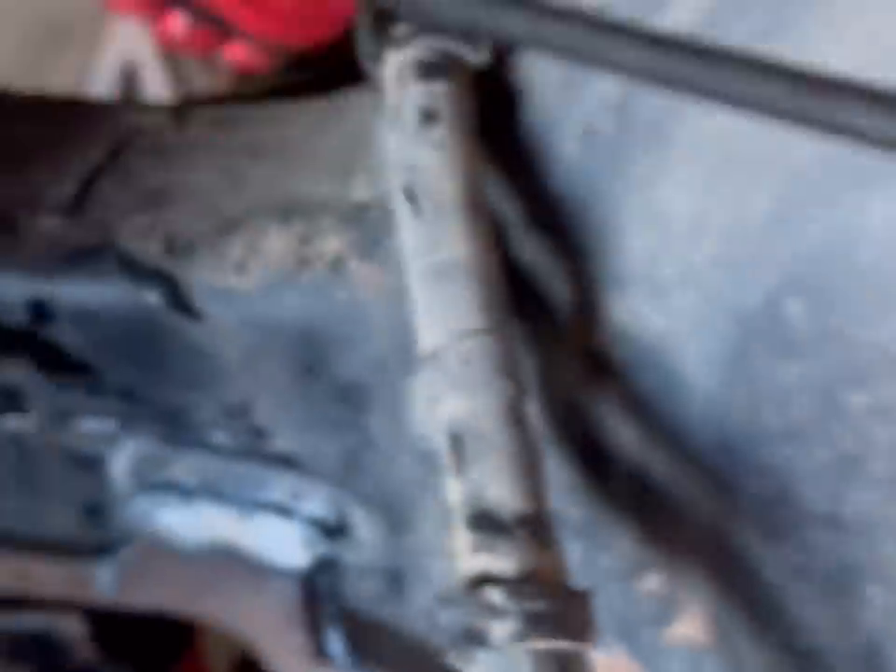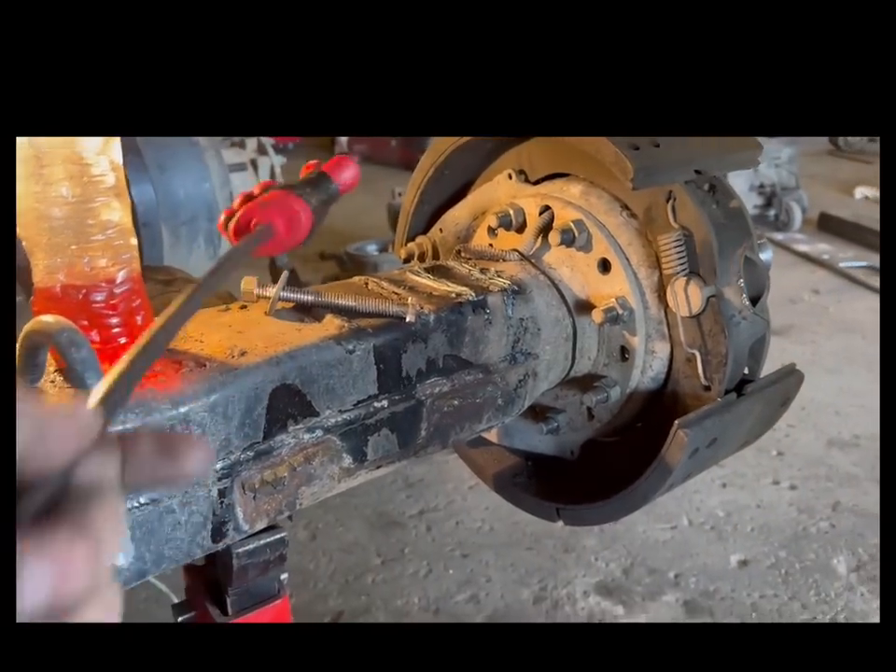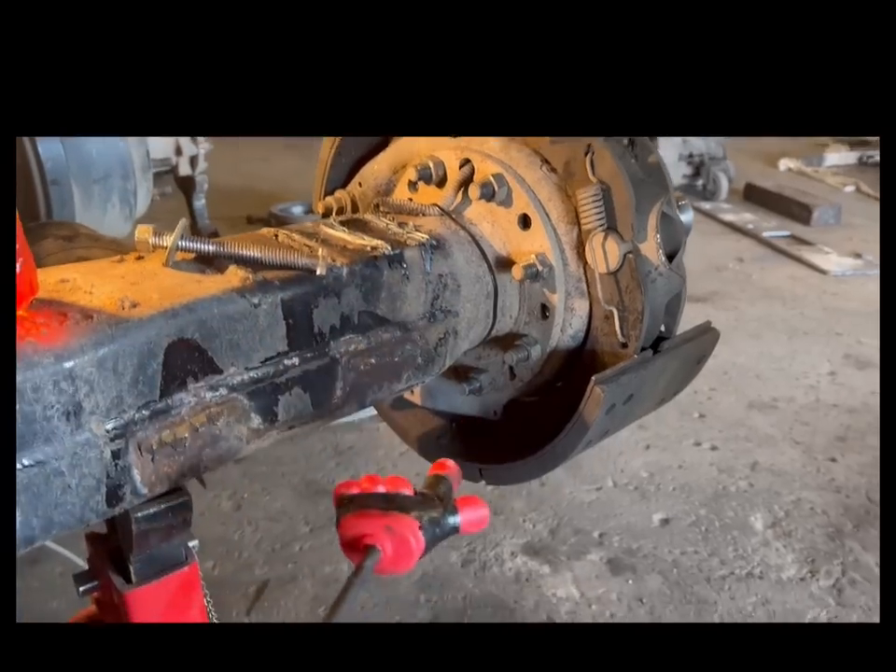Normally on the rear housing, this is over here and vice versa. So all you've got to do is take this side off, swap it, flip it over, and put it on this side. Your brake chambers can be on the inside, so that way your spring can come over the top of the axle and come down.